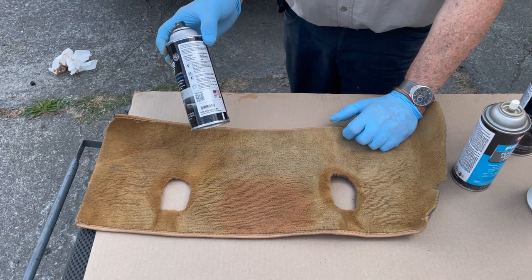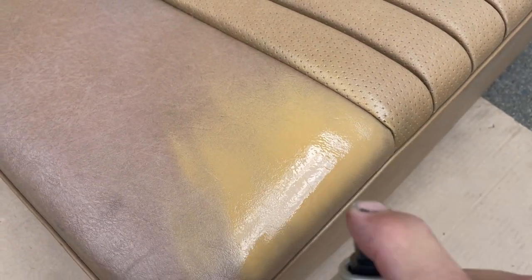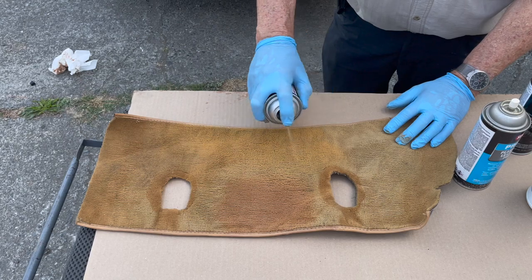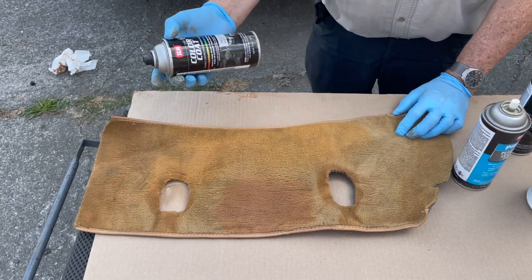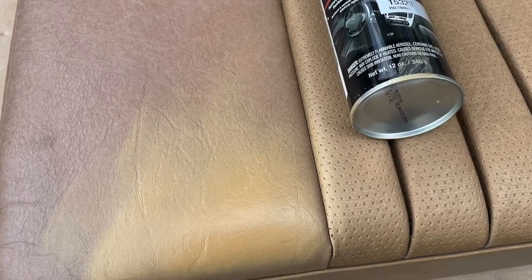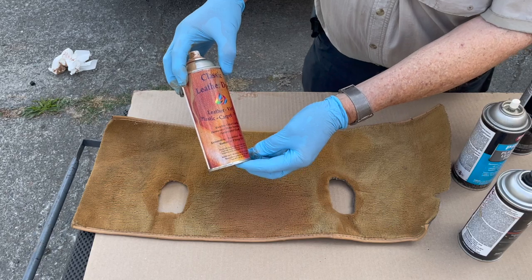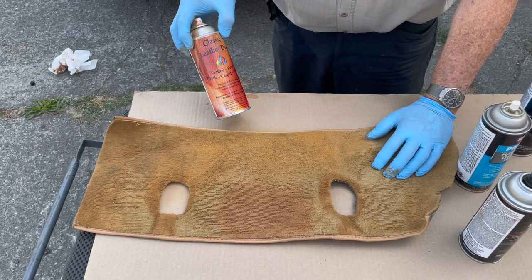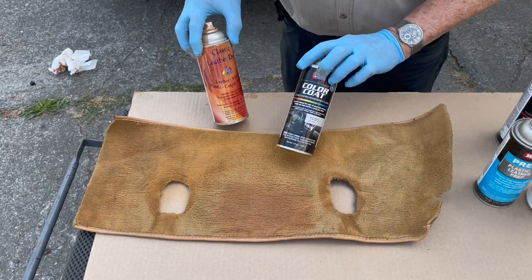Well, I sprayed this on the seats and it didn't look very good, but then I went to spray it on the carpet — look at the difference. So you're not going to ever get it perfect, but you're going to get it pretty close with this SEM spray. But this does not look good when you spray it on the seat or the door panels — it's just the wrong color. When you spray the World of Upholstery product, which I like for seats, it doesn't look right either. So I will put links in the description below to the World of Upholstery product for leather and vinyl seats, and a link to this SEM Palomino for the carpets.